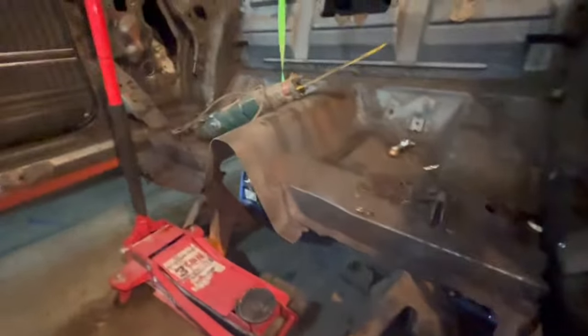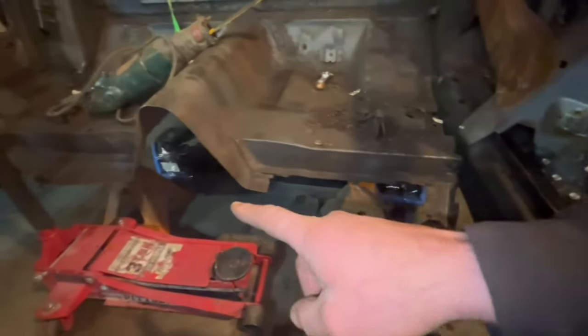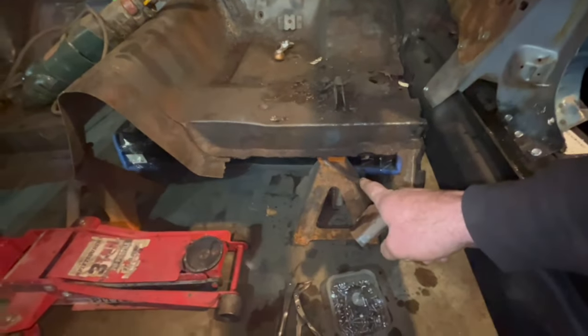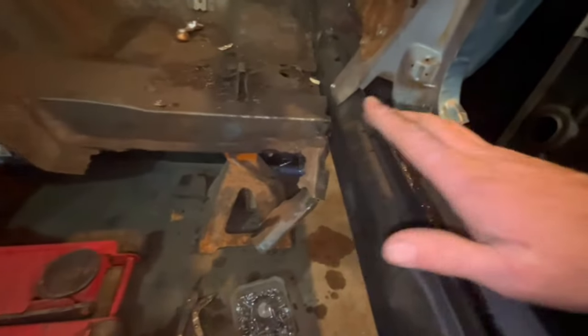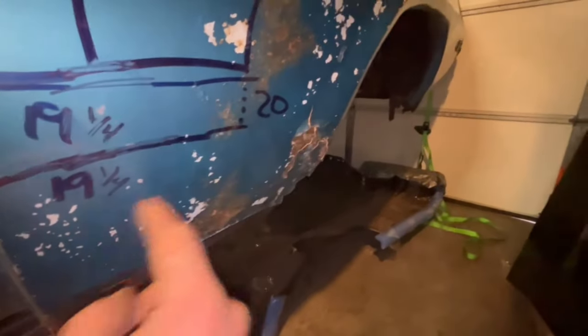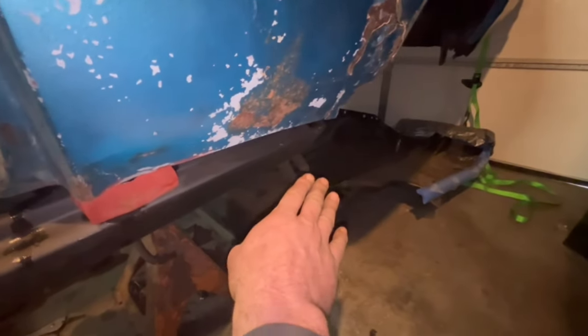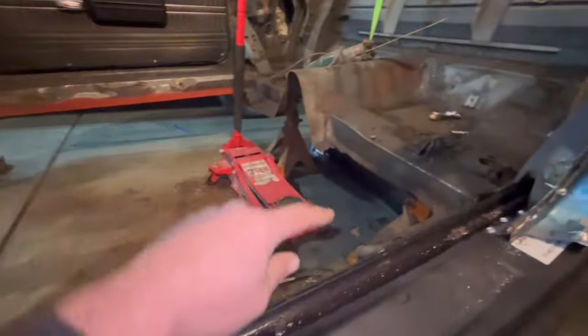We're going to work on pulling the rear floor pan out. That's one of the things that's probably not necessarily video worthy. Now I have some structure to the car. In order to do so I need to move my jack stands. My body mounts have an adjustment I made up to get the height right. I'm going to move the jack into my rocker panels but I need to keep them at the same height. Back to my numbers — 19 and a quarter and 20. As long as I get my jacks out there and I'm still at the same height, it won't affect anything putting it back together.